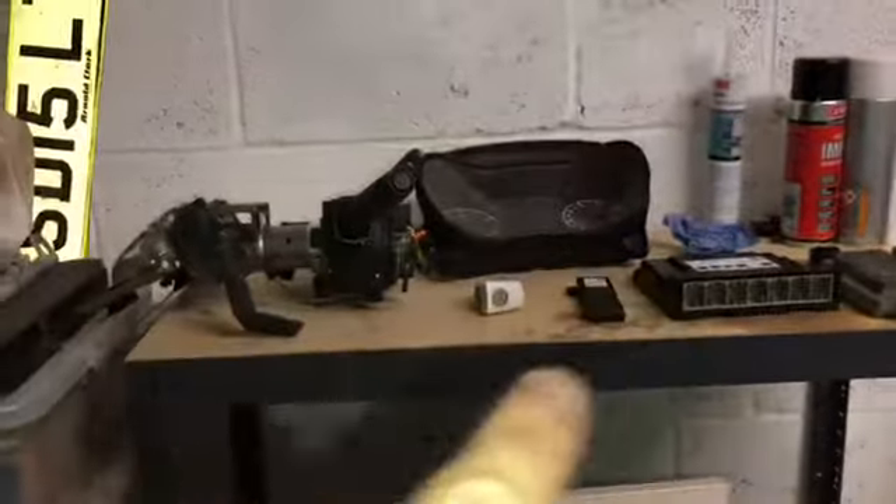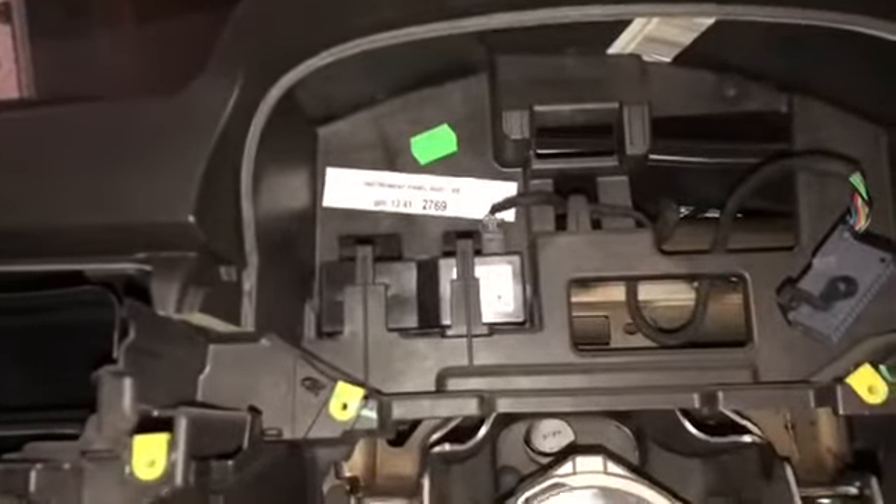I just need to get the main ECU, which I believe is behind all of that, then plug in that last ECU and I think that's pretty much it. I just need to change the lock over later on — I just want to see if I can get anything working or started. I'm in a very rare position here, underneath the glovebox, and I actually have to snip all of those little cable ties off the back and then release all the clips out of the back of the ECU. I've made it easier on myself by taking the glovebox out, so this should only take about two minutes instead of a thousand.